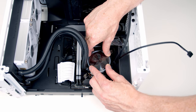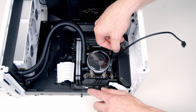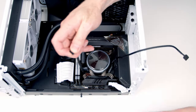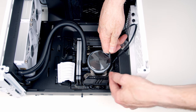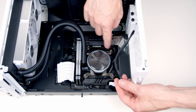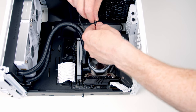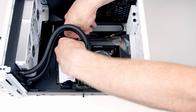We've got two cables coming from our pump. The first is a four-pin PWM connector which I'm going to route up towards the top of the motherboard to plug into our pump header. I'm just going to pass it underneath the bracket to keep the cable looking neat and tidy. Our other cable is a three-pin five-volt ARGB cable which needs to plug into the ARGB header just nearby — again routing the cable underneath the bracket, bringing it down the side of the motherboard, and getting it plugged into the header. Then I'm just going to tuck the excess cable up behind the pump cables.